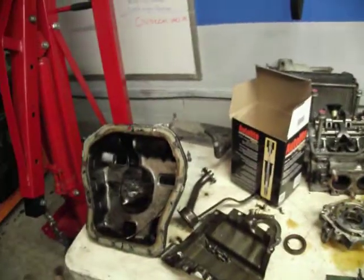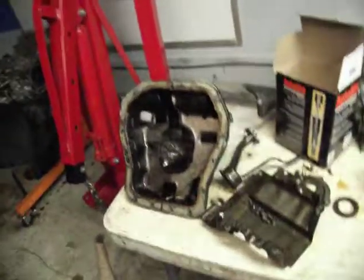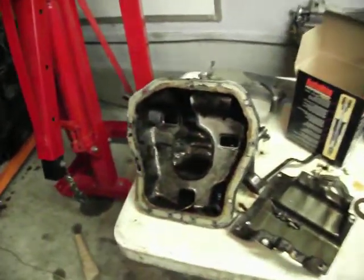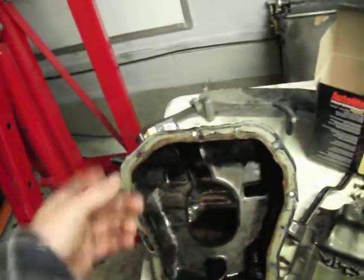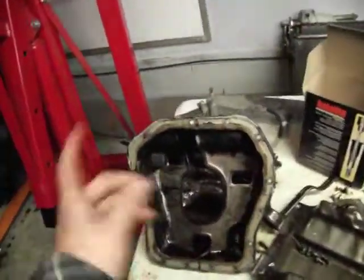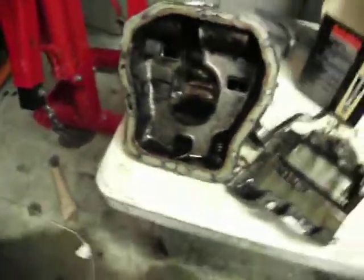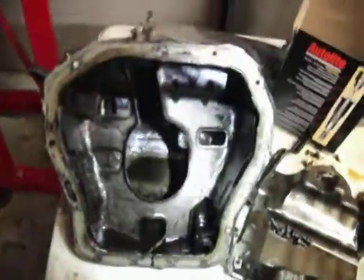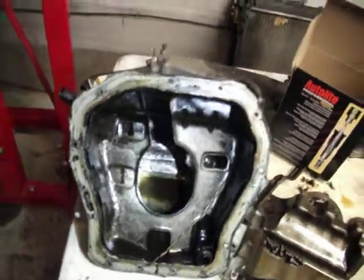And what happens is, when the motor becomes deprived of oil or gets contaminants in the oil, a very important part in the engine called the bearing scores, and once it scores, it increases the friction between the bearing and the connecting rod, and it just keeps eating at the bearing, and what you get left with is a metal smoothie. And you see all these metal flakes in your oil pan. This is indicative of a spun bearing.